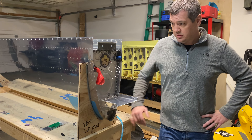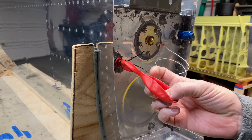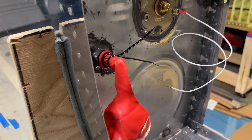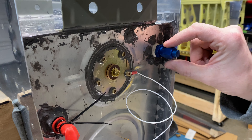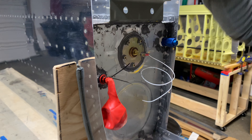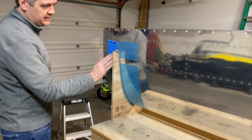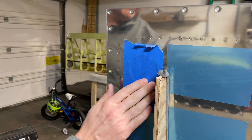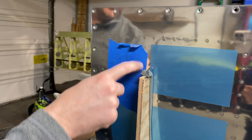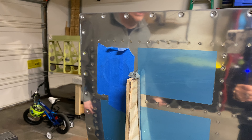We're going to test this thing and see if it leaks. You'll notice we have a highly technical latex balloon, zip tied on. I have an AN fitting over the fuel pickup — that's capped off — and I have a cap on it with some tape over the cap as well. In the past these caps have been known to leak, so the tape is an additional sealing measure. We'll remove it separately to check the rivets around there.